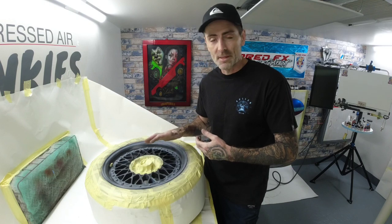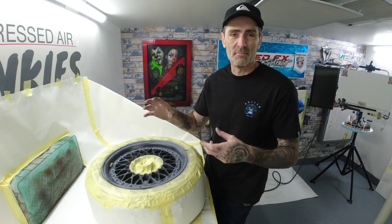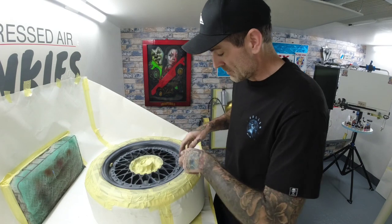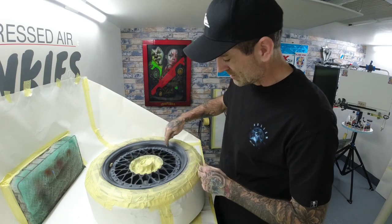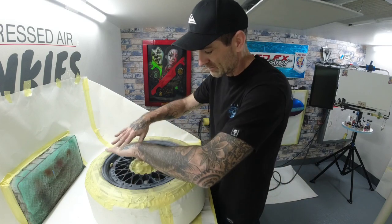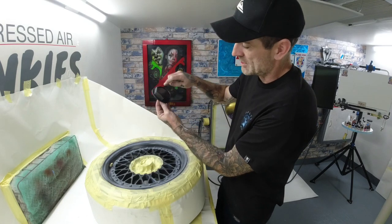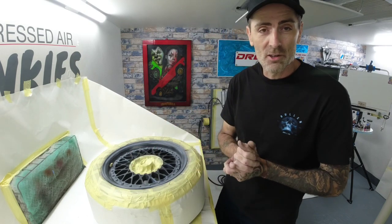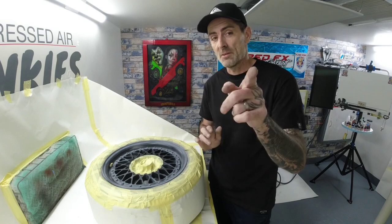We can now move on to dropping the base coat — it'll be a dark metallic grey. I've mixed a bit of dark grey metallic and chucked some black in it, just using up whatever I've got left for these wheels. We'll let that go off, and then we can start masking out all these — there's probably about 50 to 60 bolt holes to mask off. Mask that rim off once we've based it, and then we can metal flake the internal and do the centre cap in the matching dark metallic grey. I'm going to grab a coffee and then we'll move on.